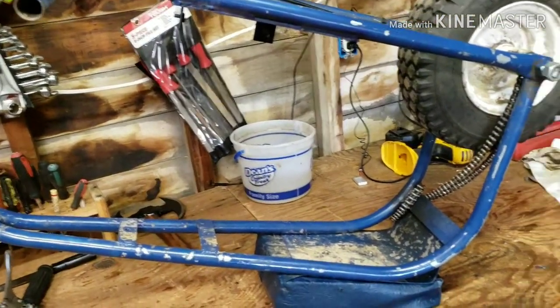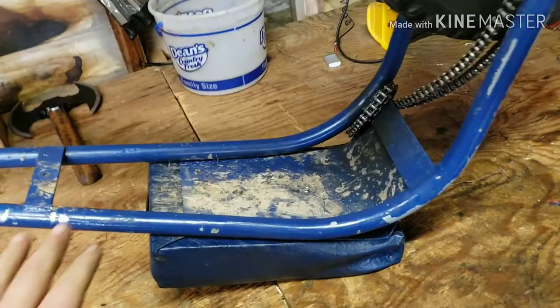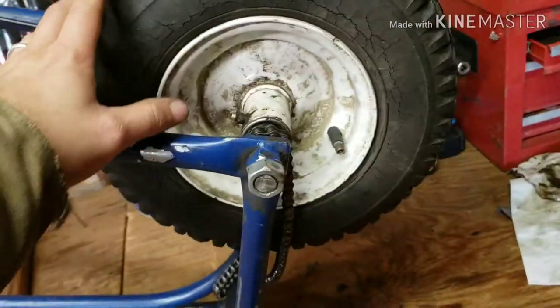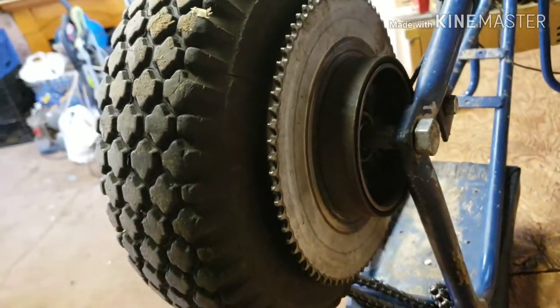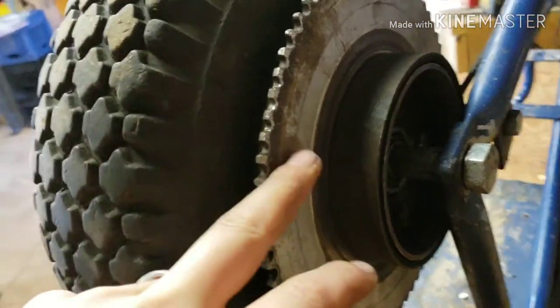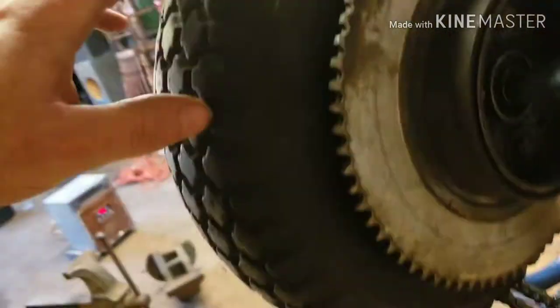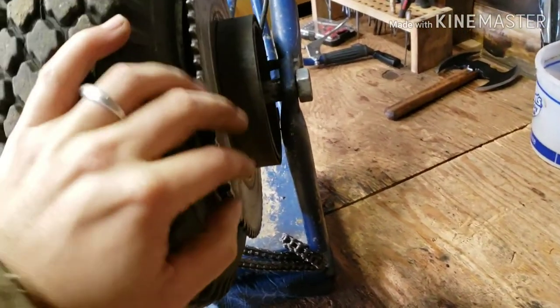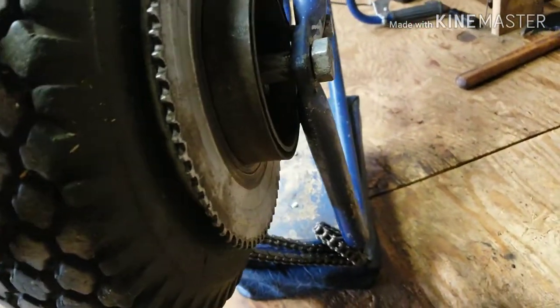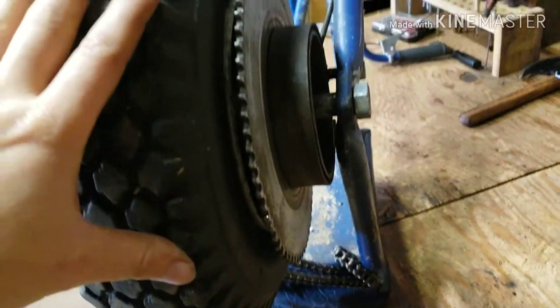What I'm going to do with this — it really needs to be cleaned and I want to repaint it eventually. That might have to wait until next spring though. This sprocket and tire, I want to replace it. I know it's on the wrong side for you guys, I'm going to have to turn the bike around. But this sprocket here — you can see — from when I blew out a tire, I ground some teeth off. This is a 72-tooth sprocket. I want to switch it to a 60-tooth, which will give me more top speed and less torque. I'm not so worried about the top speed of this thing, because it is already fast enough.